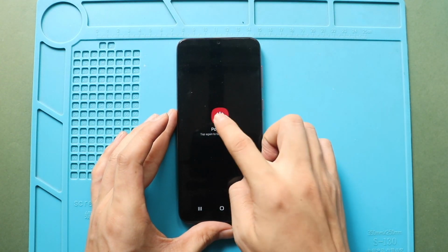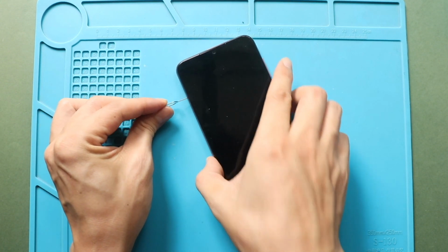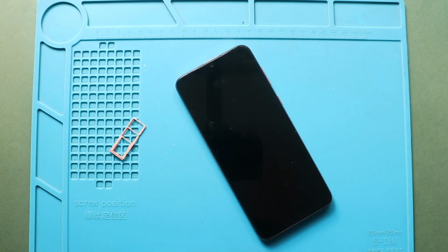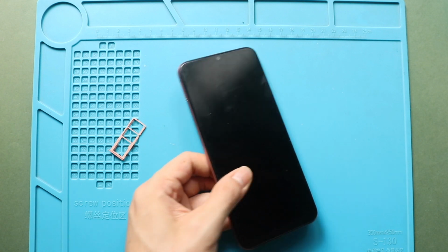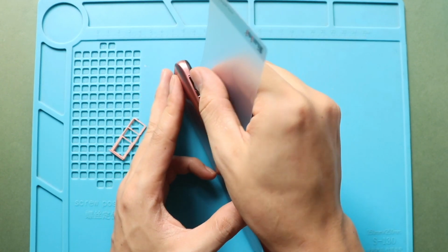Today we will show you how to replace the front and rear cameras on the Samsung Galaxy A03 Core mobile phone. To start, we need the right tools to proceed with the repair, which you can find in the description. First, turn off the phone and take out the SIM tray, and then follow with the back cover removal.